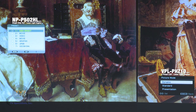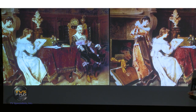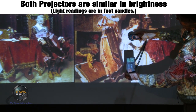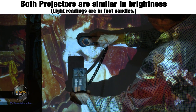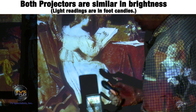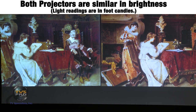We wanted to show you the modes we're shooting these projectors in for comparison. The NEC is in high brightness mode so it can be very close to the brightness of the Sony. The Sony is in dynamic mode — it has a higher brightness presentation but as with most projectors the color accuracy goes away a little bit. We're reading luminance brightness off the back of her dress: we're getting about 35–36 off the Sony, and on the NEC we're getting about 31–32, which confirms they're both in the same 5,000 lumen class.